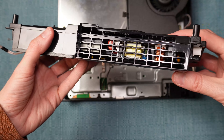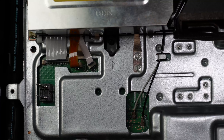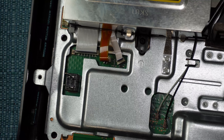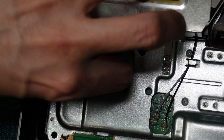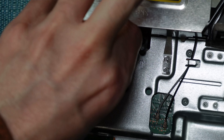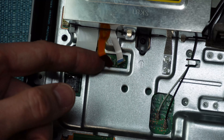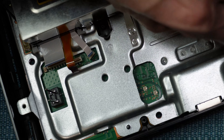With the power supply out, you can now clean any dust that has accumulated inside of it — just blow into it. Next, disconnect these five things: three are ribbon cables. The two white ones have little handles so you can just pull up on the handle and they'll come out. The brown one doesn't have a handle, so just pinch it with your two fingers and pull it out. Then unsnap these two connectors from the board — try your best to do it with your fingers. If that doesn't work, pry them off with something plastic; you don't want to use metal because it may scratch the board. When they're loose, untuck the wires.